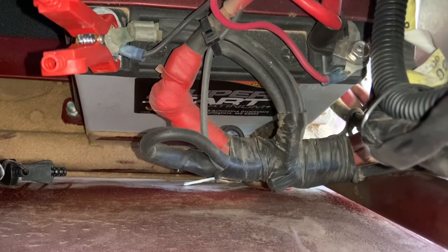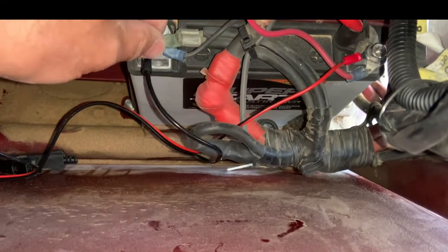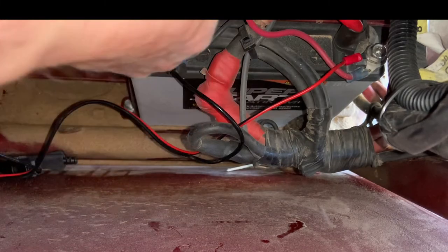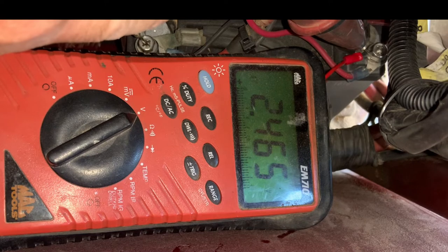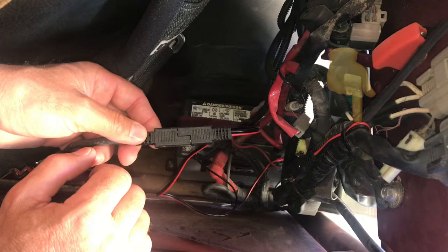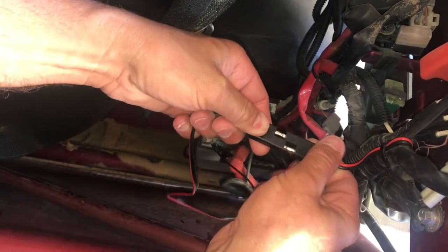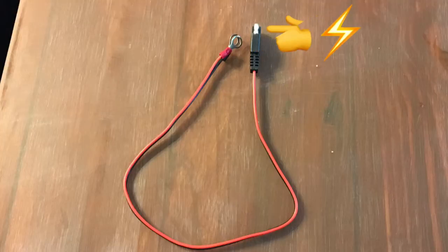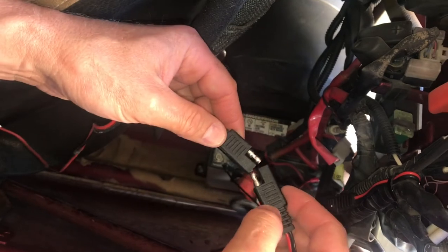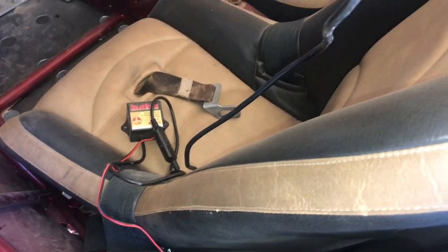I was just going to put the alligator clips on the solar panel and hook them up every time, but with the position of the battery in this little sand car, it was easier to put the battery leads on it and just plug it in and out that way. I'm hooking up those leads to the battery, red on positive and black on negative, then plugged in the solar panel — I'm getting 12.17 instead of 12.14, so it is charging. I also took one of the extra pigtails and zip-tied it around some of the pre-existing wiring harness, so when I'm riding I plug the battery end into that to prevent the bare positive end from touching a ground and causing a direct short. When I get back and park it in the shed, I unplug it from the harness and plug it back into the solar panel so it charges while it's not in use.